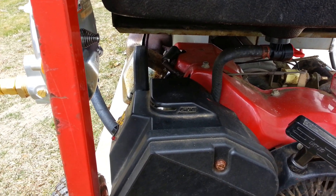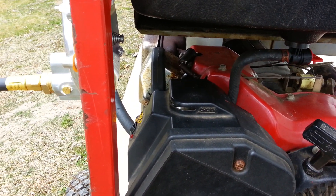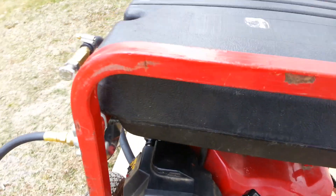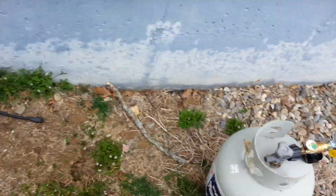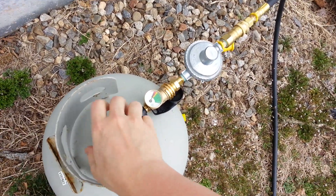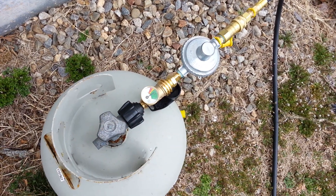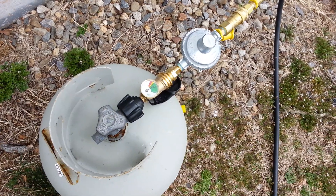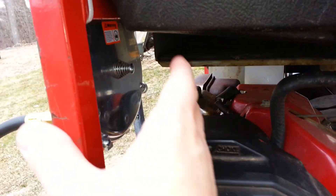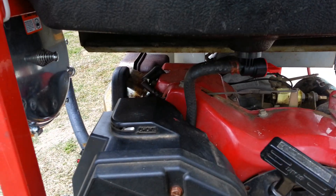I'm loading it up to probably about 48 to 50 amps. The frequency meter right now unloaded is about 63 Hz. What we're going to do here is turn on the gas — it's got one of those valves where it'll click once it's fully gassed up. Now push this a little bit — good, choke's off.